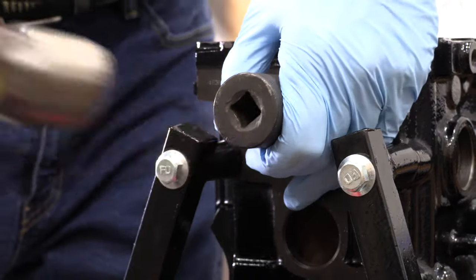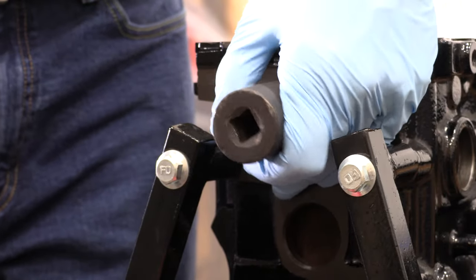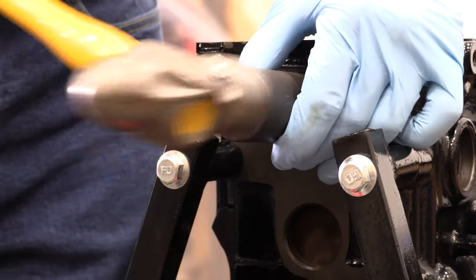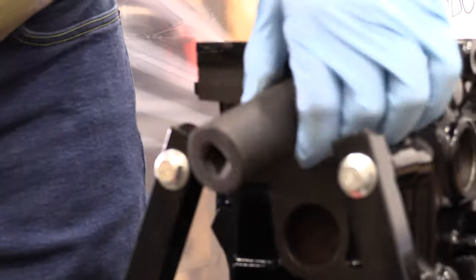Everyone else that has easy access to the hole and more important things to do gets a 27mm socket and regains control of how straight and how fast they're driving in the plug. You'll be here all day with the stick, and it doesn't have to be as complicated as this thing can make it. Stack a socket on the die and drive that sucker in.